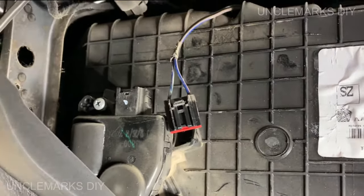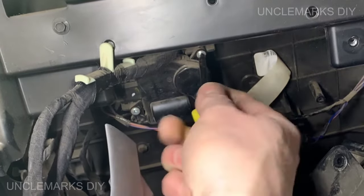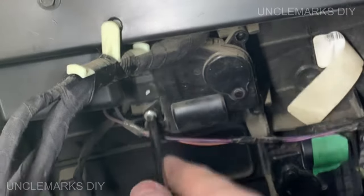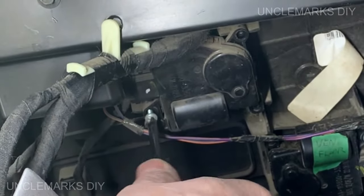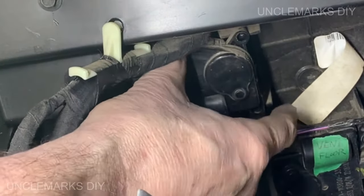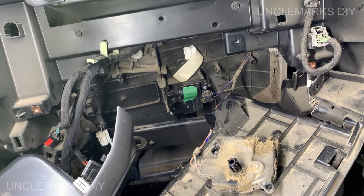If the motor didn't move, you could try to replace it, or you can remove the motor and manually turn the little door. The one in the glove box — you want to turn it to cold before you take the motor off, because the little flapper, the blend door, is weighted and it's going to want to fall down or go to cold anyway. If you have it on hot you can have a problem — it's not going to want to line up. The reason you go to one extreme or the other is because that little door is weighted and it'll fall if it's not sitting the right way.